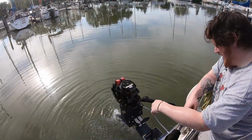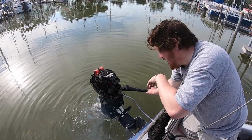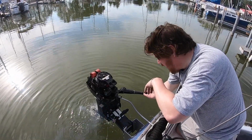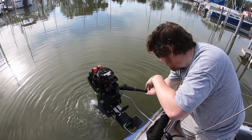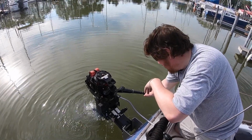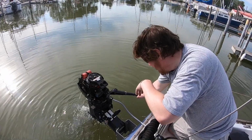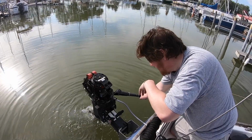Screw, which I think is on the right side of the carburetor. Yeah, it's over here. We can play with that. So once you're off the throttle entirely, do I want it all the way down to shift? Won't that kill the engine? A little bit above shift, wherever you're happy with it being at idle. Well, shift is going to be the lowest idle you can have so you don't damage the transmission when you shift. So see if it stalls, or if it feels like it's going to stall, try to catch it.